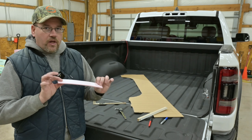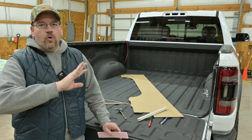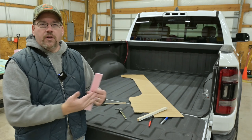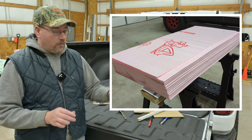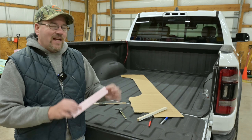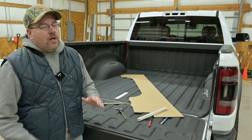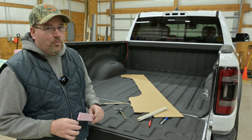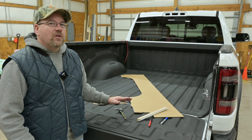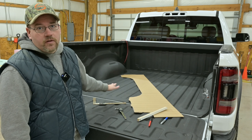Last night we made another trip to the hardware store and got quarter-inch fan-fold insulation — the kind you use underneath vinyl siding to make a wall flat. It's advertised as a quarter inch but actually measures 0.2 inches. So we're going to stack two layers in the grooves, which will leave it just a little proud — we're okay with that. It'll add a bit of insulation and make the floor more level. If it ends up too much, we've got kill mat sound deadening material and could put strips across the high ribs to make it perfectly flat.